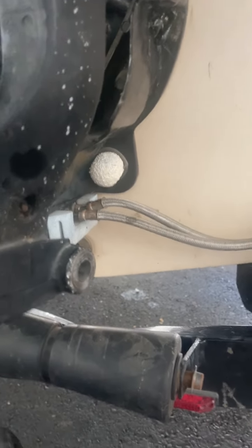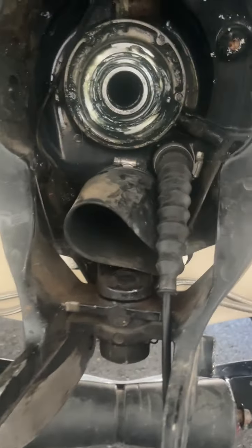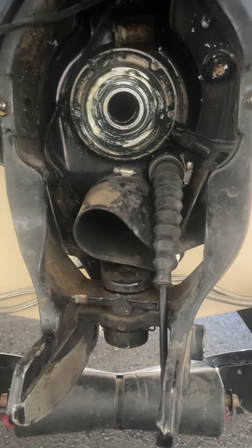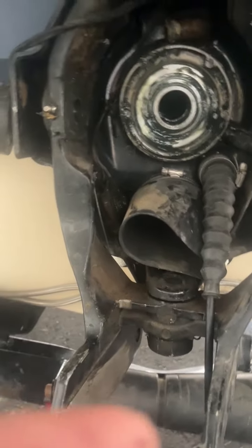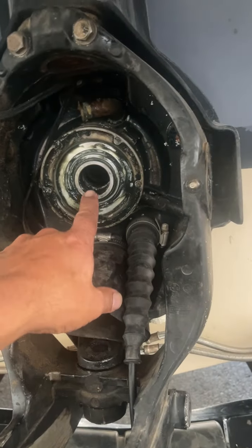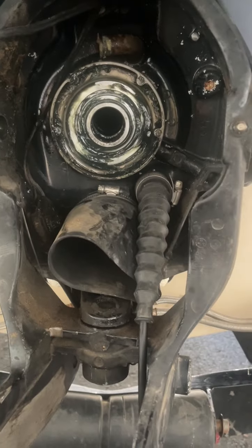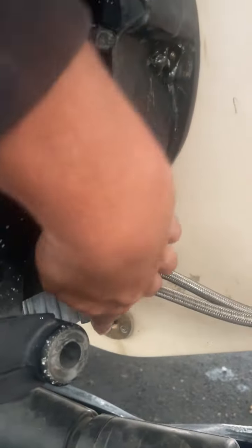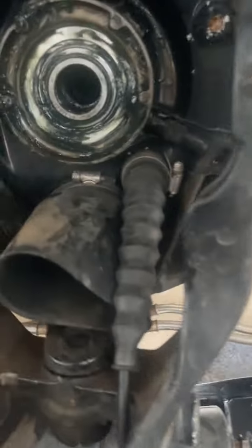So next, what we did is I disconnected all the batteries, put the plug in the boat, lifted the front of the end way up, and then we started filling it full of water. And I didn't get a drop out of anything out of here until it came out of the gimbal bearing. So that means we can rule out, there's a seal right here. There's a seal right there, we can rule that out because it would have started dripping.